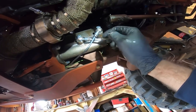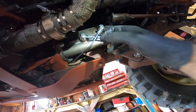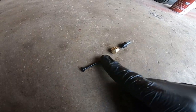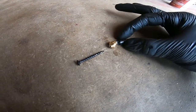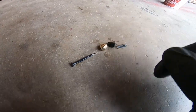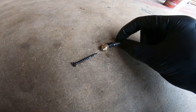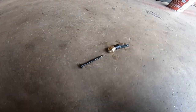It's all together now. I'm going to bleed it at the calipers just to make sure, put some pressure on it, and see if these fittings leak. This will give you a visual on the pieces we removed: the drywall screw, the brass seat, and the residual valve. It's just a little squishy rubber check valve with a little spring — it has to overcome the spring to let pressure out of the line. Very simple, but causes lots of trouble.